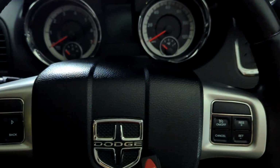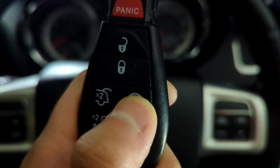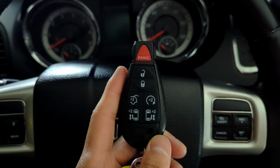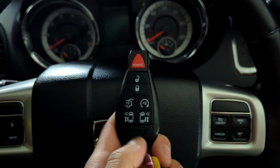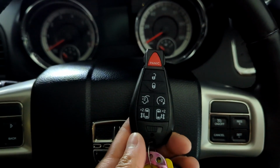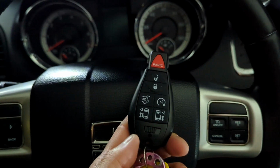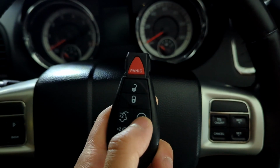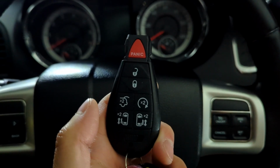So you have to buy another key that has a click here. You can hear that. I just bought this off of Amazon, link in the description below. And I've already programmed this to start up my car. You can use the Appcar DiagFCA to program keys as well, so I used this to program the key, and then I just went to Home Depot to get the key inside cut. But yeah, you're going to need this one with the clicking for the remote start before you start this process.